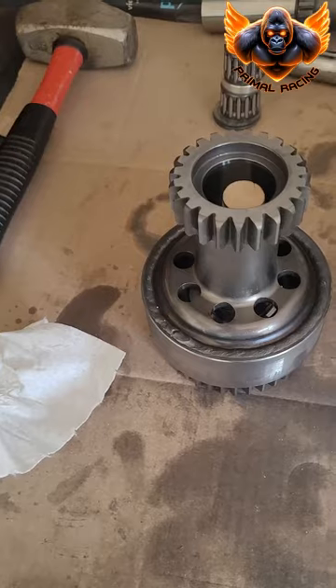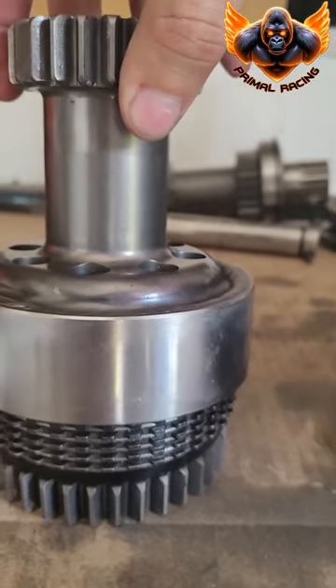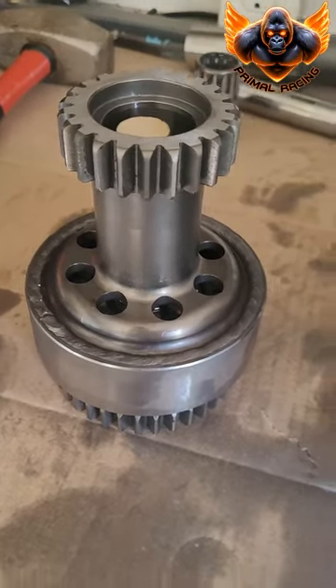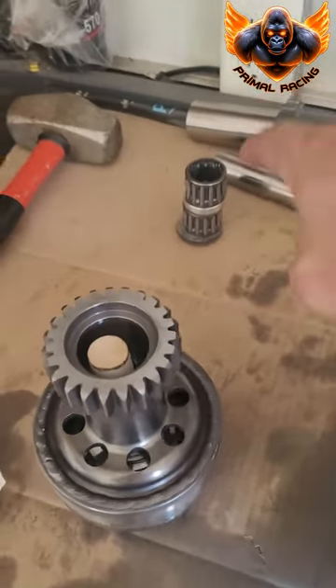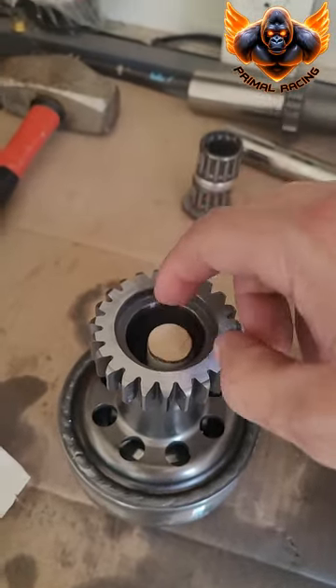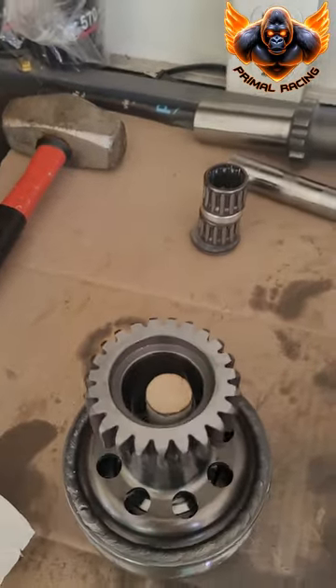Got everything cleaned up. Assembled the new clutch pack — it's all in there. You just turn this as you put that on and then it'll all line back up. Follow the diagram for clutch packs: put the pressure plate first, then disc, then a plate, then a disc and a plate — just alternate. These roller bearings and spacers all go in here. It says to use an assembly shaft; I found a small wood dowel that'll fit the bill.